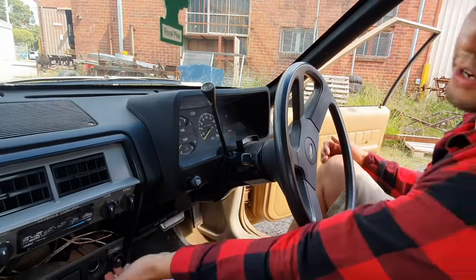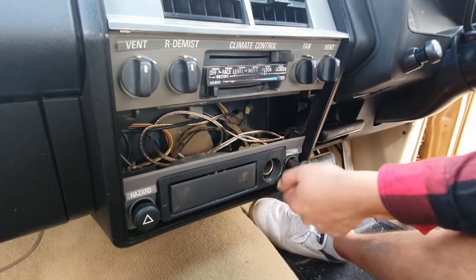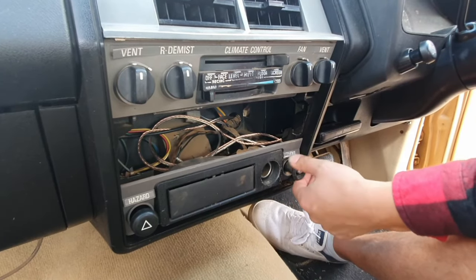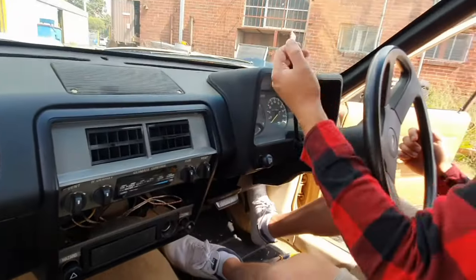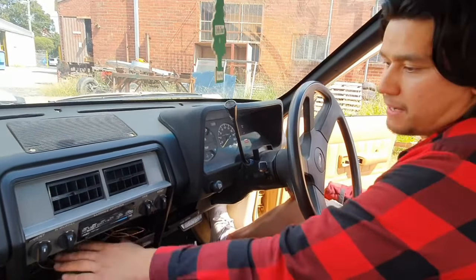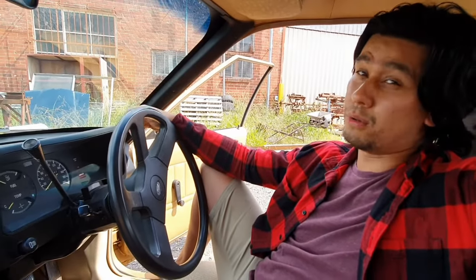This car is a carburettor, so you use a choke. In the mornings I'll pull it out to something like that. If I'm a little bit audacious, I'll try to push it in a little bit too soon — I normally don't really wait for the car to warm up. I'll just push it all the way in basically, and then often at the lights just down the road from where I live it'll stall. Usually I just quickly put it back in park, open that again, start it up and she's fine. You see a big old hole here — I've wired up speakers in the back, I just haven't got around to putting them in there. The sound of a 4.1 litre just gets me going in the morning — really, that's all the music I need.